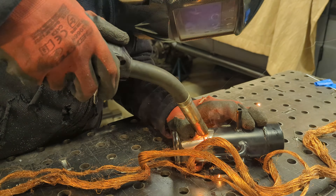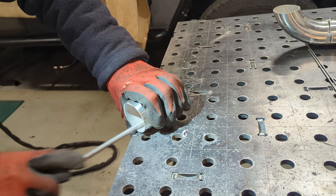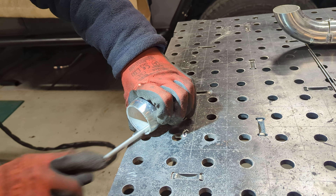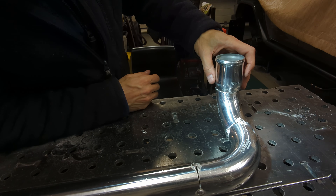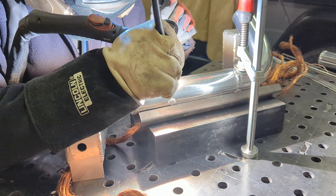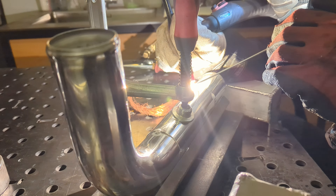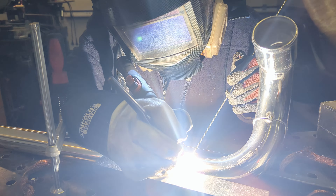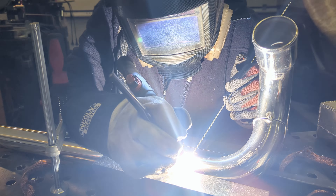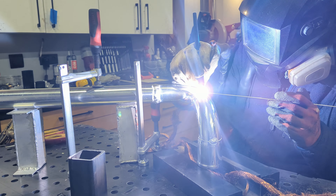The last thing to do was to fabricate the inlet, and this was something I did not plan during the body rebuild. I finally decided to mount it inside the existing fuel inlet compartment, as I found it the best possible solution. To do this I had to cut, bit by bit, an 80 mm diameter hole for a second factory-fit grommet. I did not think it through before and I had to pay a price.